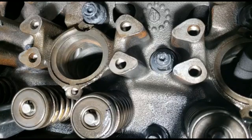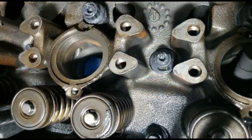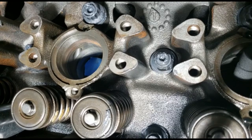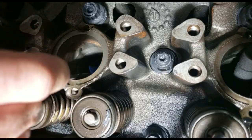We're on the head now. One trick I like to implement is to get a little bit of tape and shove it down in there so it covers the injector nozzle hole on that cup. The reason you want to do that is so that no shrapnel goes into the cylinder and scratches your walls, or any dirt in general. Literally push it downwards so it's covering the hole.